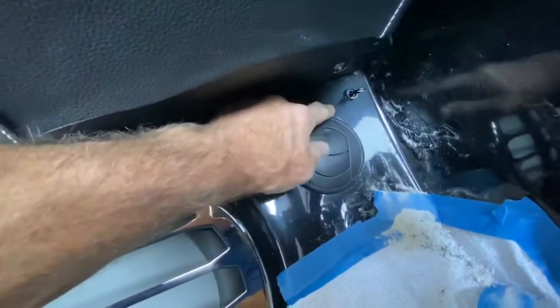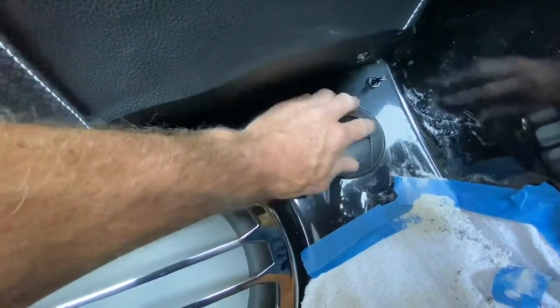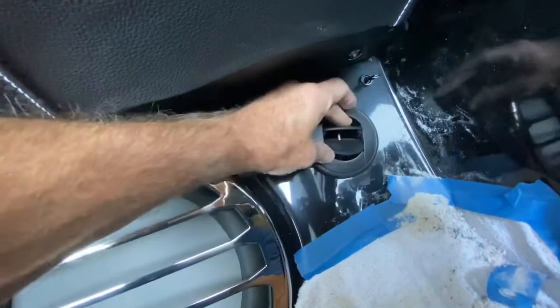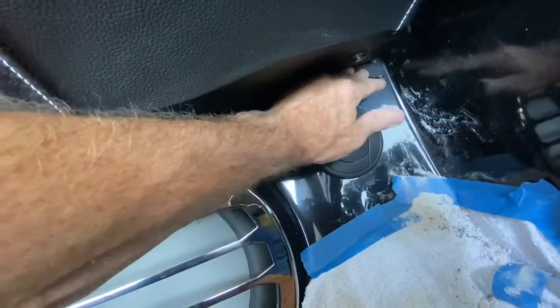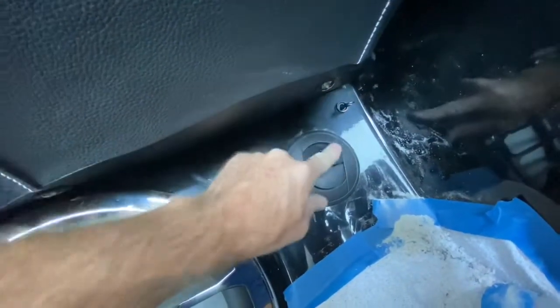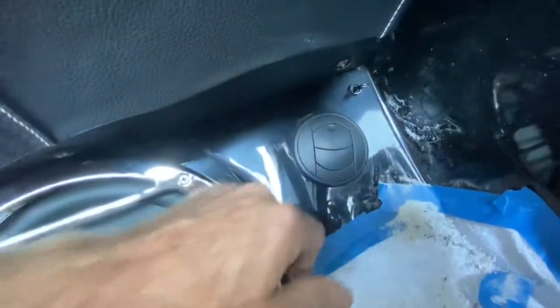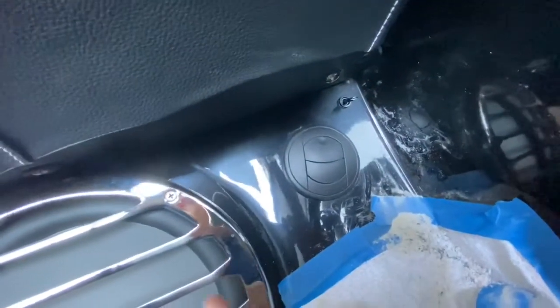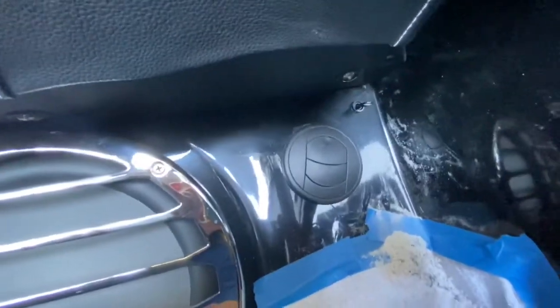I decided to put the switch down here out of the way. The only chance of it getting turned on accidentally is if you're down here pulling with the heater vent, but I wanted it as far away from everything else as possible so nobody would mess with it. Because it's wired off that second battery, it could drain that battery and possibly burn up the pump if left on — so it's just gonna have to be a memory item.